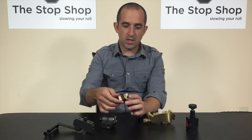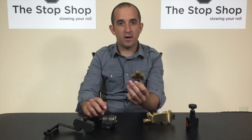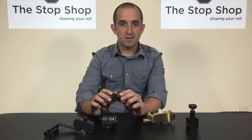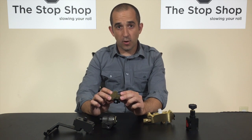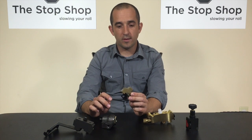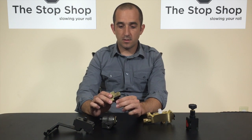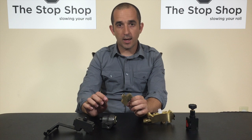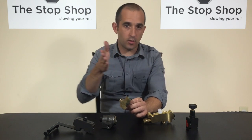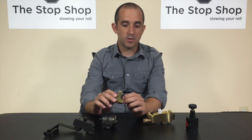The next one is a proportioning valve. This is a GM proportioning valve that mounts inline to the rear, found on disc brake cars. Under heavy braking conditions, it starts to restrict the amount of pressure going to your rear brakes. That'll keep your rear drums from locking up under heavy conditions and allow you to get adequate pressure to the front brakes before that rear end locks up and starts making you lose control.